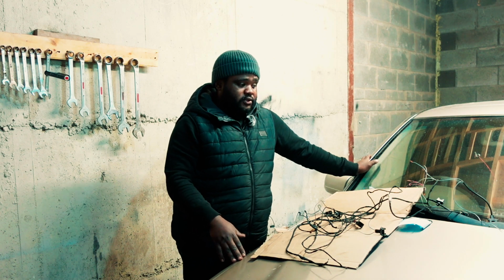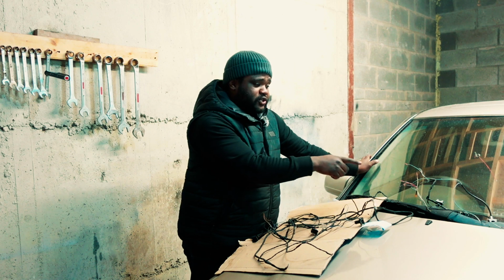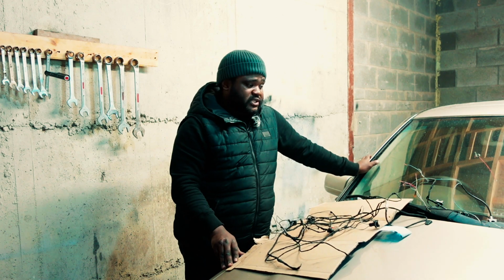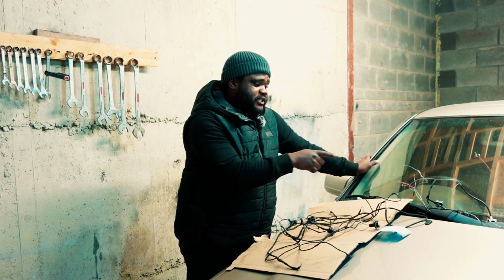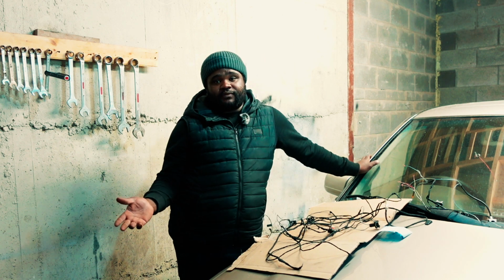But anyway, today I'm going to try and replicate this old injector wire, because I've got better new injector wires that I got off the later model of the W202. I think that was a 98, because this one is a 94 with the biodegradable wire. This wire was from the 98, and I think it will serve me better because this one is literally in bits, like we've seen in previous videos.